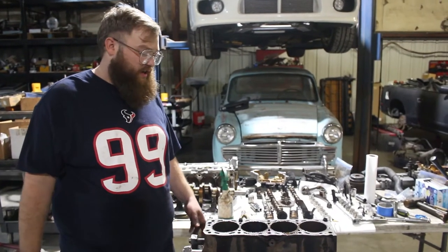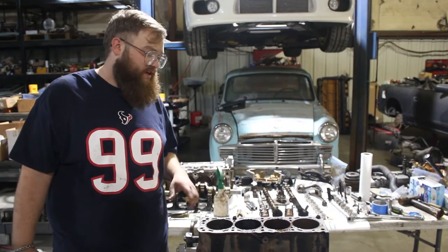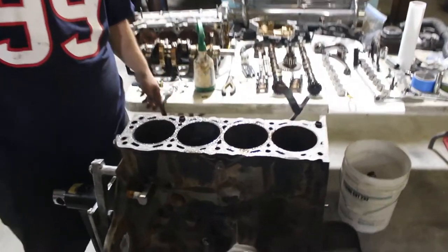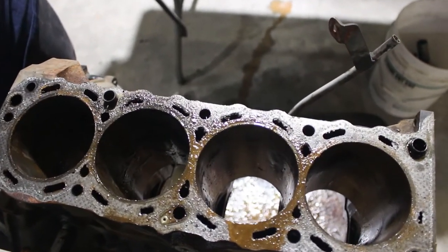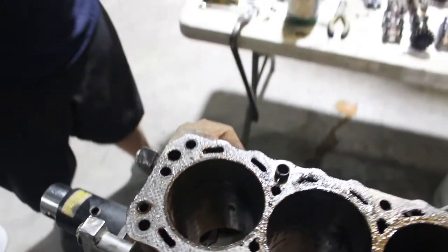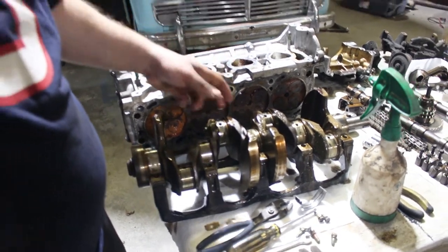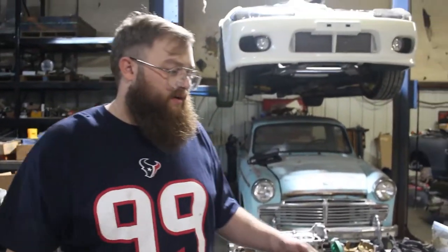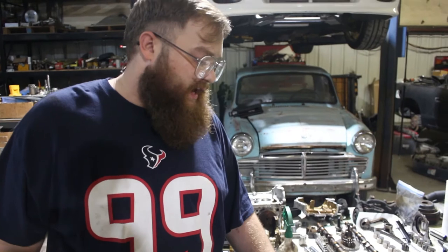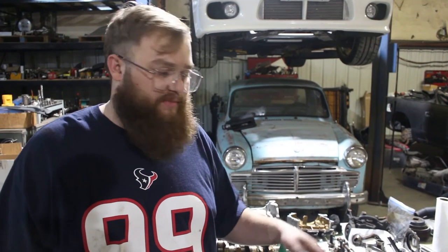As you saw in the footage, there was a little bit we didn't film just because Amanda had to help me, but we got the pistons out. We did have to use some persuasion since they were stuck in the bore, but it ultimately looks like surface rust only. We'll know from the machine shop — we can do some measurements beforehand. Thinking about doing a 20 over. We'll get this cleaned up. The crank I was wanting to keep and use — other than it being kind of milky, the water line in the bottom of the pan was just at the bottom, so everything still looks really well. It needs a good cleaning but should be able to get the crank cleaned up, have them check it over, balance it, micro polish it, and get this block bored.